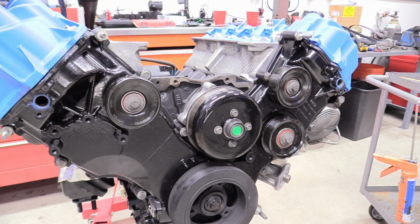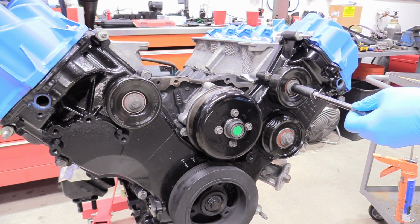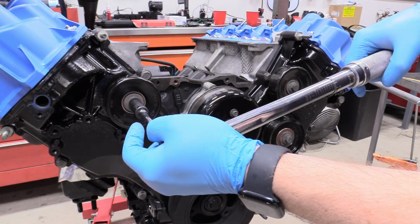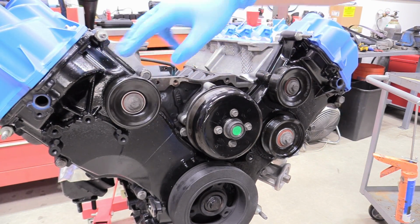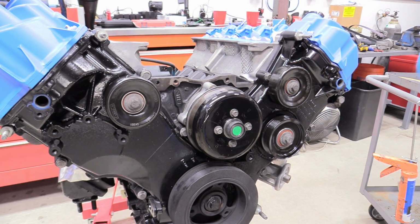And the torque spec for this is 18 foot-pounds. So go ahead and torque them down. And if you don't have a torque spec, it's perfectly fine. Just 1 arm tight is acceptable. Make sure they spin nice like that. Ooh. Oh, that's going to be so much better.